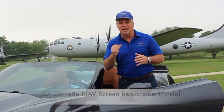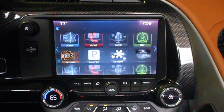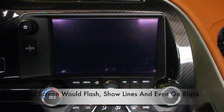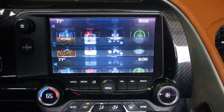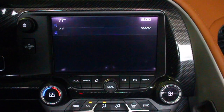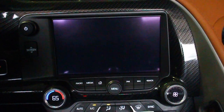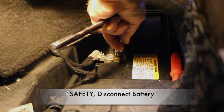Let's go ahead and get started, and keep those cars on the road. Let me show you first some of the problems I'm experiencing. The screen would start flashing, lines going through it, and sometimes even black out. Now this video does not show how to remove the dash and center console — those are on other videos, and I will list those links for your convenience. Because one of the main wires came loose at the terminal board, I'm going to go ahead and replace the entire nav screen.